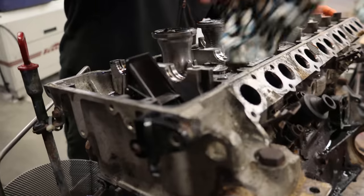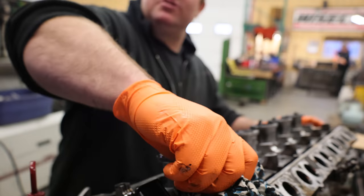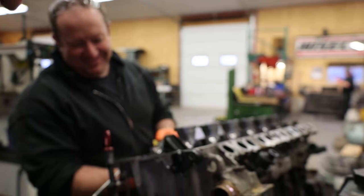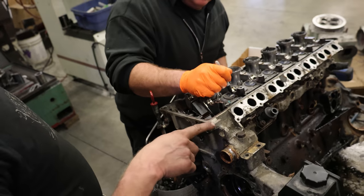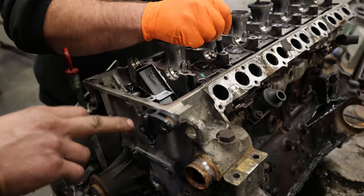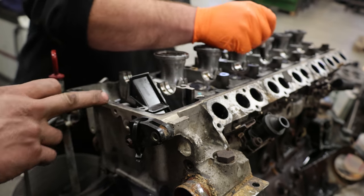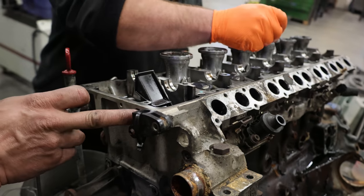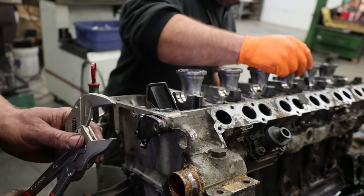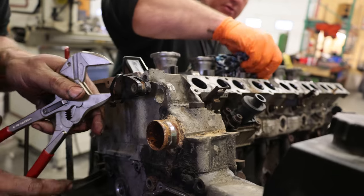You see this pin goes through — that's why the Mercedes mechanic makes so much more money. The only thing keeping this valve plate on is this pin that goes right through the head and holds the guide for the timing chain. But the steel's probably oxidized in the aluminum, so it might be a little bit of a pain to get out. And then it's plastic, so that plastic's pretty brittle now.